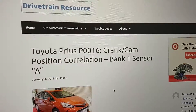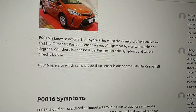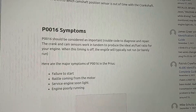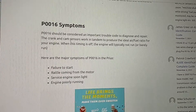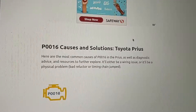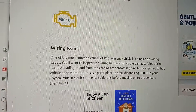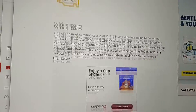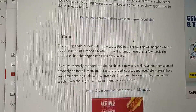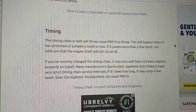So we got this error and I started looking on the internet for possible causes. It has to do with the crankshaft position sensor not being correct. They're saying it could be a failure of a harness, a failure of a sensor, or several other things. But in this car, it was sitting and I guess it leaks oil over time, so it wasn't a wiring issue and it wasn't a bad sensor. It was because the timing chain was being stretched because the car was completely out of oil.